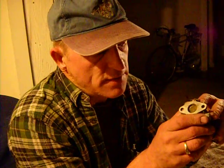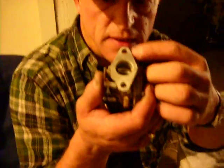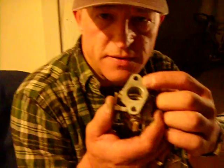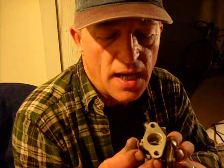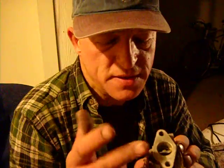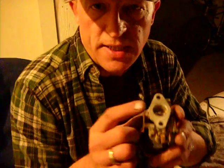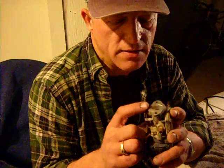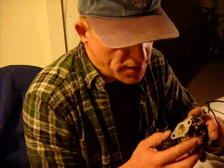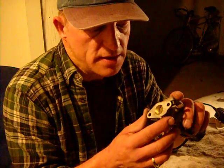Later on you can look at going on the inside. But there's an issue with that — if you look closely in here, you can see that there are three little holes. Those are the fuel delivery mechanisms; that is the air bleeds, and that's where it pulls from to get the fuel in. So you don't want to hit those — that will change the dynamics. The pressure is greatly inside there. So when you put a groove in, you're going to skip over the air bleeds. That's all there is to it.